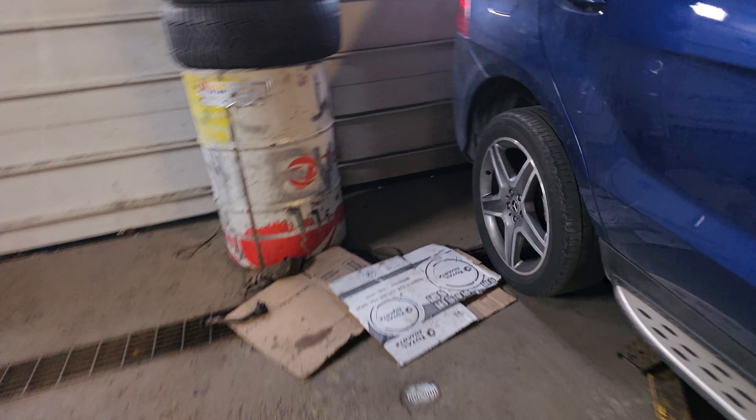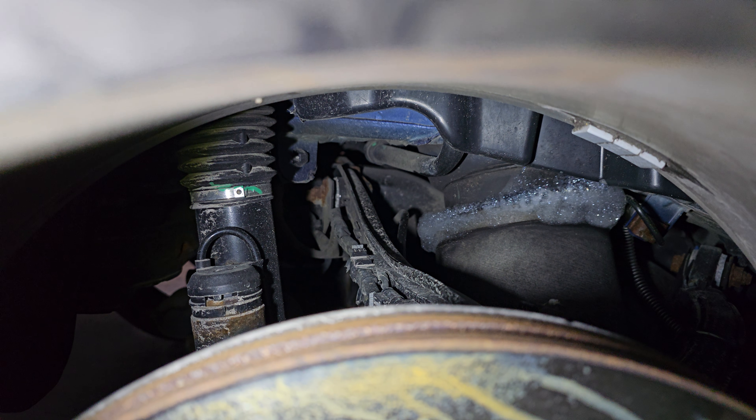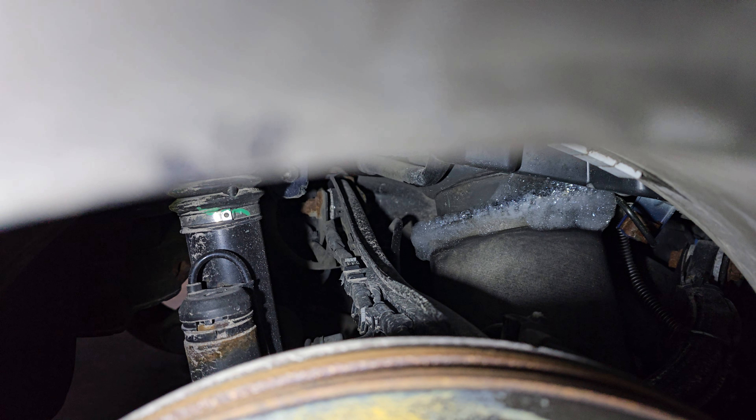We go to the back right here. I'll place a light so you guys can see. I already sprayed the soap back there — you can see at the neck of the rear shock absorbers, or the airbags, all the leaks.